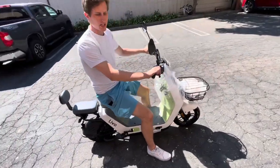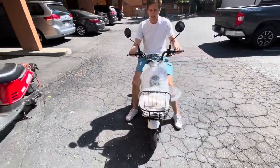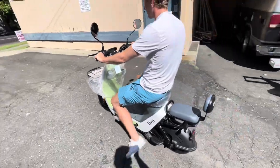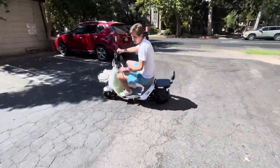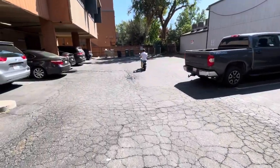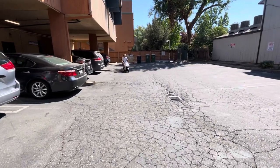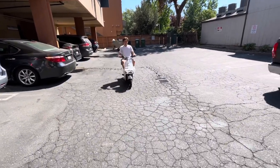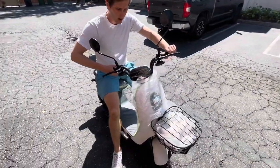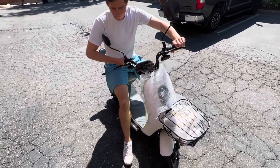For your first ride, check the handlebar alignment — sometimes it'll be off a little, but it's very easy to adjust. Ride it real slow, keeping it straight with your feet down. Ride it around and if it feels off you'll know. This one is slightly to the left, so turn it all the way and apply slightly more force until it feels like you're moving it.